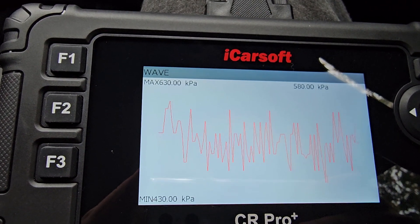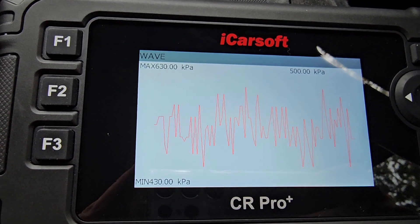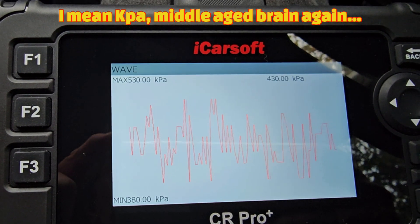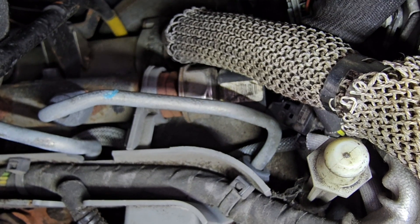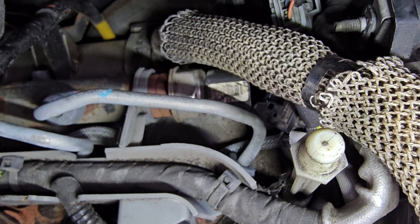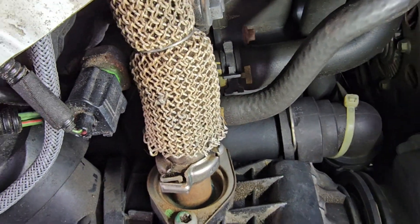I'm slightly intrigued by the fuel pressure reading. I've got that other fuel rail pressure sensor that I got off salvage, so I might unplug the car connector and plug it into the one sitting on the side to see whether that then drops down to a lower level. A quick check shows 500 kPa which is about 70 psi - that seems a little bit high for a car that's not running. The connector came off the sensor easily enough, but actually the EGR valve pipe is in the way, so I might take it off.